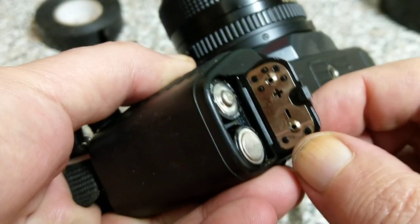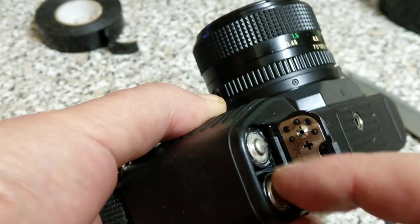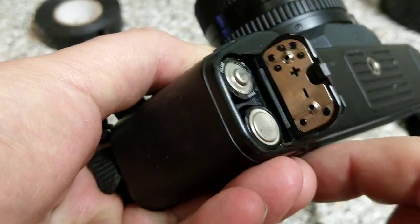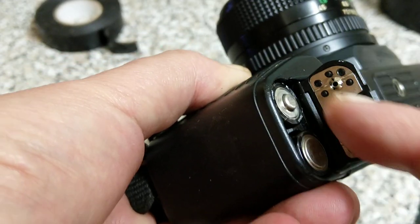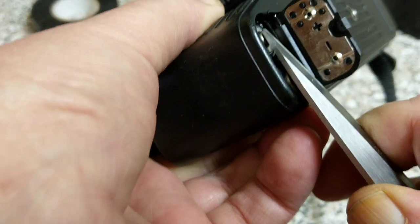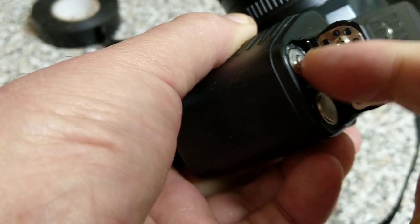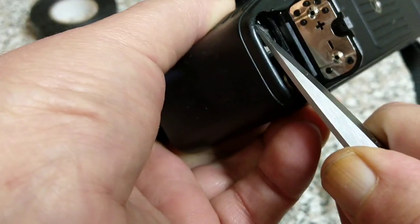On this one we're okay because we don't actually have the door. But if you don't have the door, this is how the batteries go in: positive near the lens mount, negative towards the back. And then you just need to connect these two together — that's all this part does. I can show you that with this pair of scissors. If I just short those out — you can see the camera's working fine without a battery door on. You just need a piece of metal to short those two together and your camera will work.